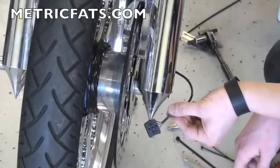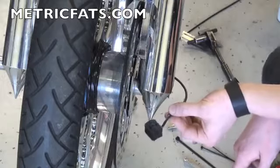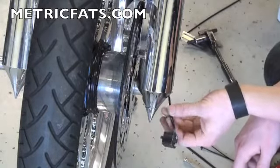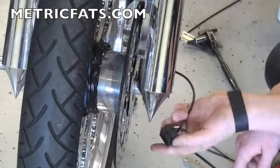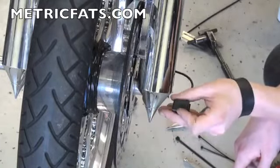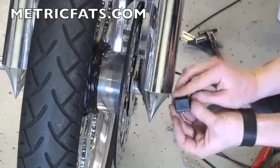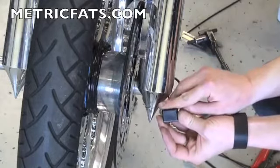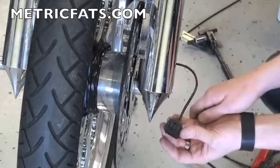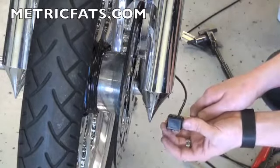All right, as we said earlier, we ran all the wires from the battery on the bike through the controller and down to the front and rear wheel, and each one of them terminates in our brush block. The brush block has 4 contacts, spring-loaded, and a cover over the back. Everything is pre-soldered. Do not take these apart. If you take them apart, you'll break them, and then you'll have to send them back and buy a replacement.